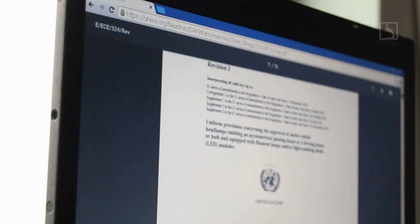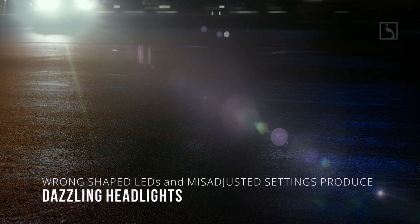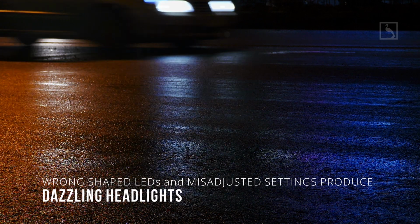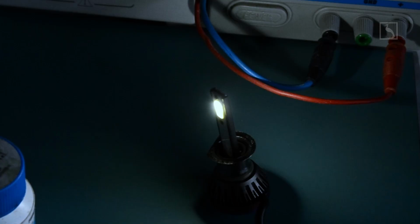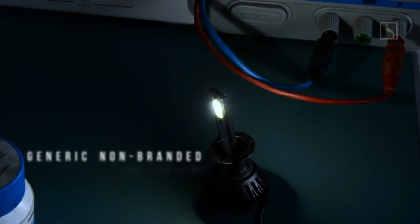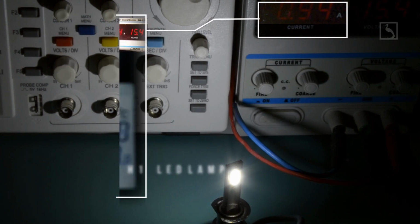Main failure reasons were: Motorway authority declined the mod. Traffic participants got disturbed by side reflected rays. Driving experience, even if slightly improved, was really not much better than the halogens over a classic non-lens mirror projector. The new LED's light faded with time, or got blinking and dimming while the engine was running hot. All of them needed replacement in about 4 to 6 months.